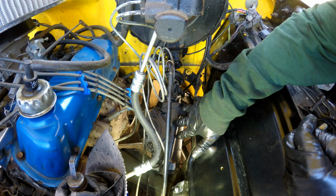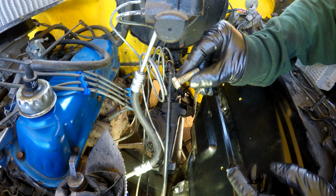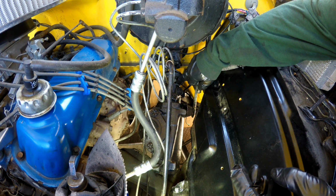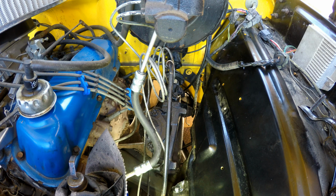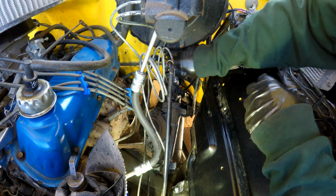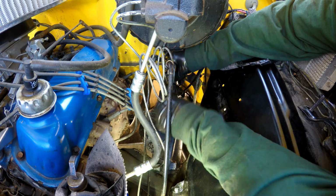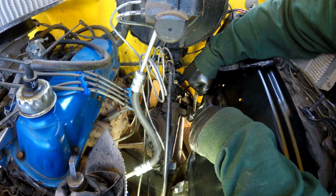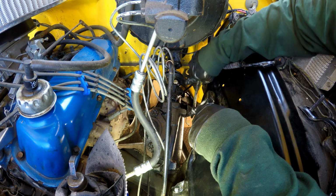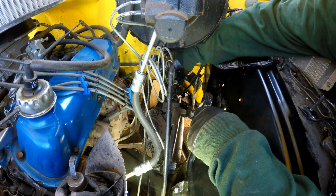While I'm under there, I'm going to be lifting with the pry bar on this box while I put in the bolt that slides in the groove. We're going to temporarily tighten this just to make sure that the threads are catching. I know it's going to be hard to tell because the GoPro's so far. Me trying to pull this out, it's not coming out, because it's already on threads. If I can spin it by hand, you know that the threads are good.